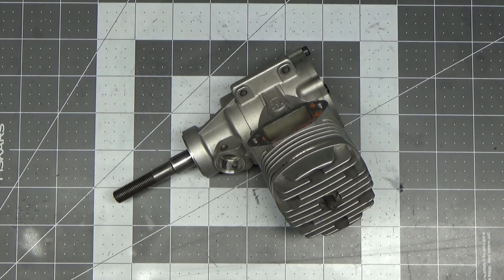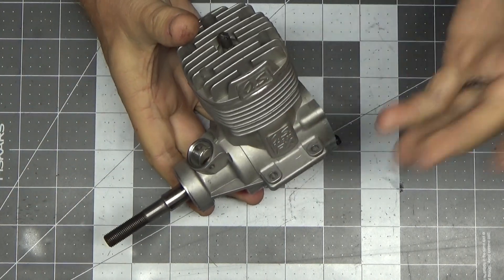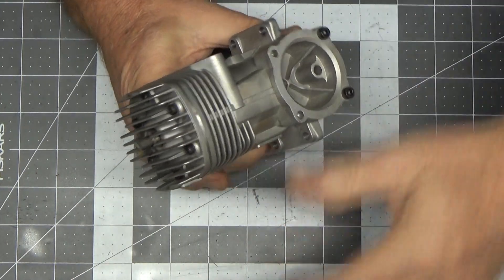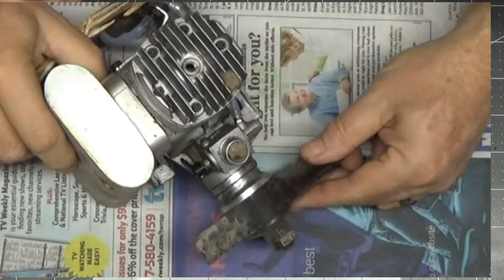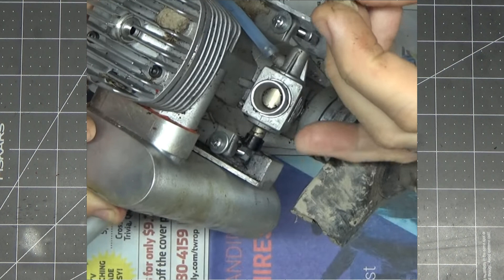This is video number two of this crash engine. I just finished brushing it off, took it outside, sprayed it down with alcohol, blew it with my air compressor, and pulled all my plugs out. Off camera I took the two rear cover screws out and straightened this bracket. I want to call your attention to something from the first video - the throttle control arm appears to be closed, and that's backed up by the next picture where I pulled the dirt plug out and you can see the carb barrel is also closed.